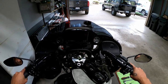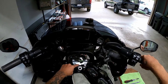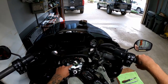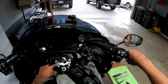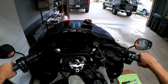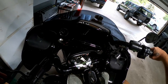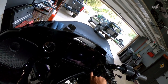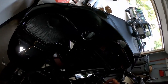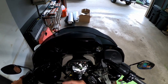I already have them pretty close so we'll leave it like that. Now the biggest thing here is when you're adjusting this you're going to put it forward. There's a little tab underneath that's going to want to keep it from moving forward — you just have to loosen up this plate just enough so you can sneak it by. Once you sneak past it you're in the clear. Another precaution — watch your turning clearance. If I turn this all the way to the left I don't want my bars so far forward that they'll hit my front fairing. Turn it all the way and check your gap — that's looking pretty good right there.